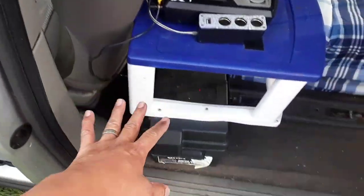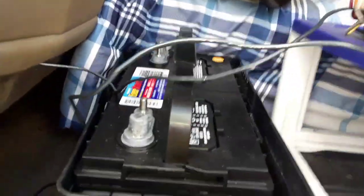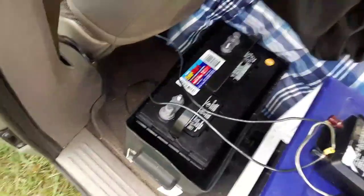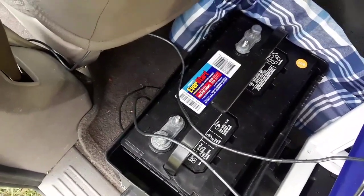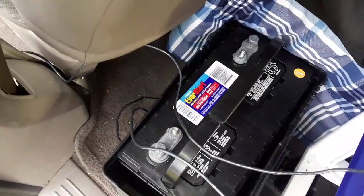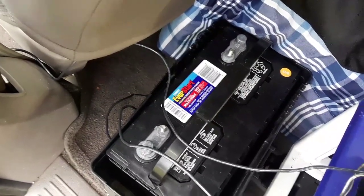What we're going to do today is fix the system by adding a house battery. I've got an RV battery here that I pulled from Little Blue 2 — it's an EverStart Max 29DC, 114 amp hours, 12 volts. The difference between this and a regular car starting battery is that this battery is designed for boats and RVs. It's mostly designed for recreational use where you're pulling the power down almost every day and then charging it back up, making it a better choice for a house battery.